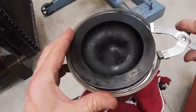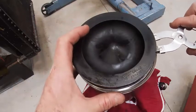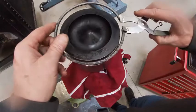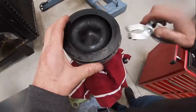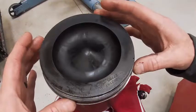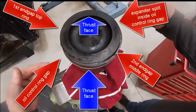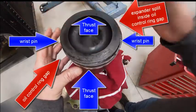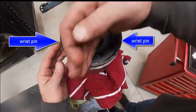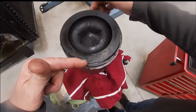This one doesn't have any markings on it, so I'm just going back the way I took it off. When you do this, you want to spread it no farther than you have to. We're going to put our compression ring on next. There's no marks on this, so just make sure you pay attention. With new rings, they're going to have some sort of dots or marks. So that's in. I'm going to take and put this end gap — I don't want it in line with my thrust faces or my wrist pin. I'm going to put this one 180 degrees from it. And then I'm going to take my oil control ring and put that 90 degrees from those. So there's a split here, here, and there's also on the expander inside the oil control, there's a split there too.